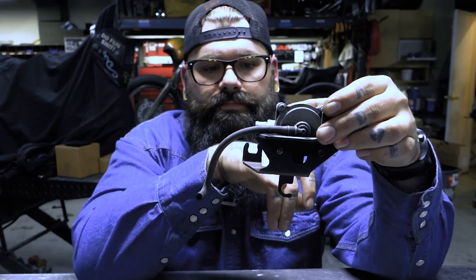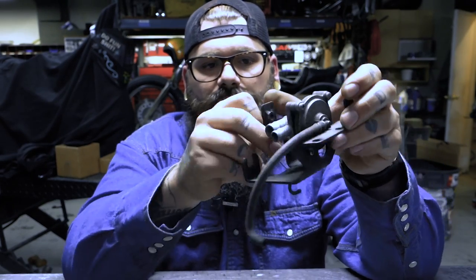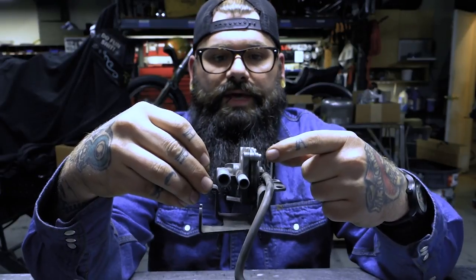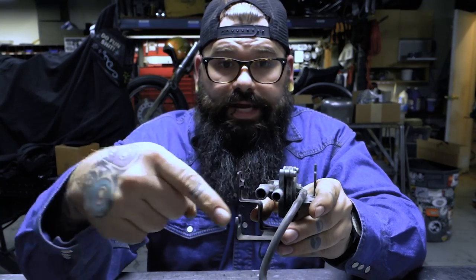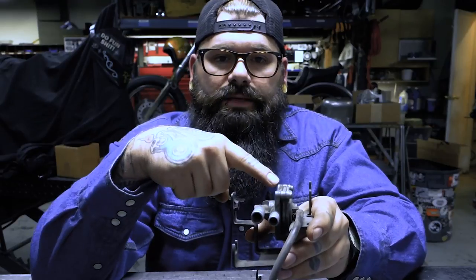You've got your idle control over here, and a choke cable up here. There's going to be a little shield thing that screws in right here, but this assembly is a recalled part because there's a rubber diaphragm on the inside that actually goes bad. It will prevent gas from flowing from here — which is where your gas tank connects — and this goes to your carb, so gas comes in and it can't get out anymore.